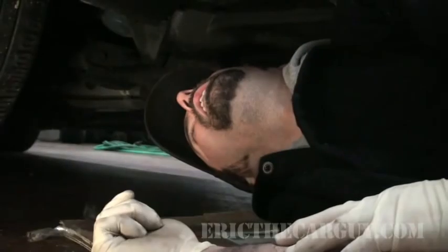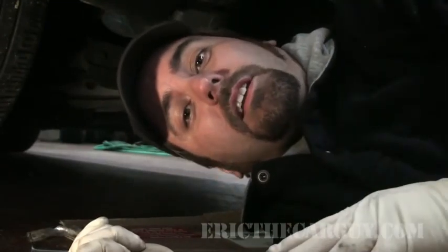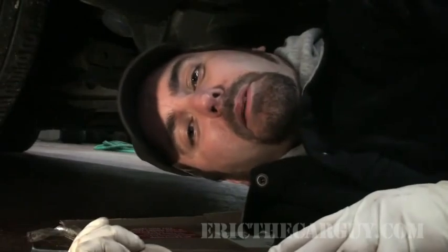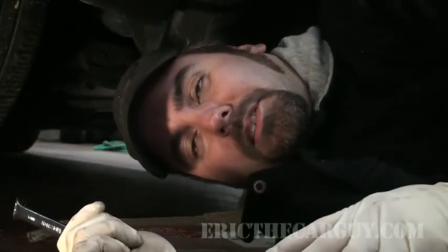You have to get up under the car and find the drain plug on the oil pan. It's important to find the one on the oil pan and not something else — you're going to let the oil out of the car and not some other fluid that might be vital to something else. On these cars, it's nice because these aluminum pans usually have it cast right into the outside, and it says 'oil' on the outside. If you're not sure, consult the owner's manual.